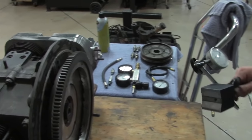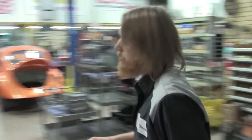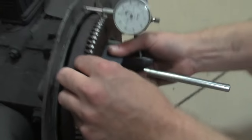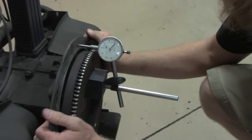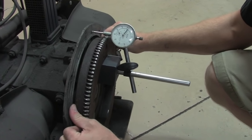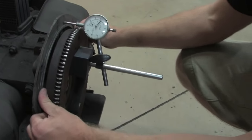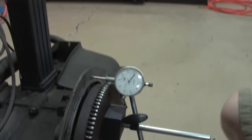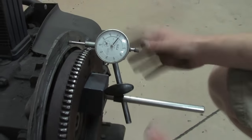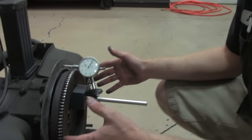Now we are going to bring you over to an engine that has terrible end play — it's a worn out old 40 horse that has been down the road plenty of times. This bad end play is in excess of thirty thousandths. When they get worn out this bad, the rear bearing is moving in the case and there's a good chance the case itself is not saveable once it gets disassembled. You'll also have flywheel rear main seals go out every fifteen hundred to two thousand miles. When something is in this condition, it needs to be rebuilt.